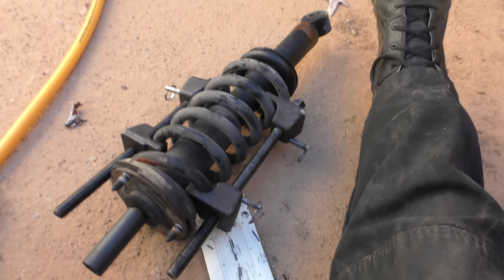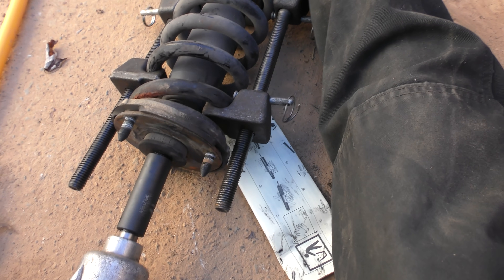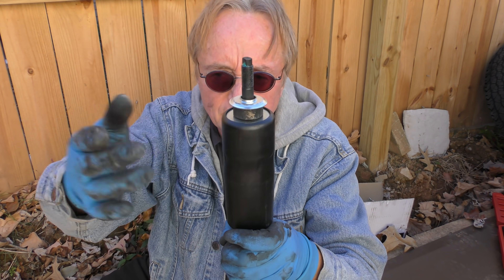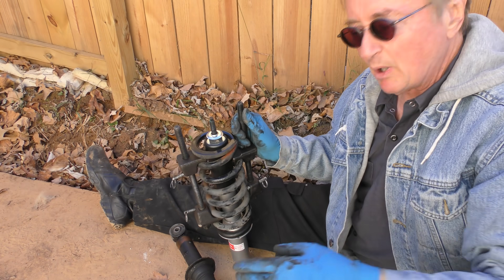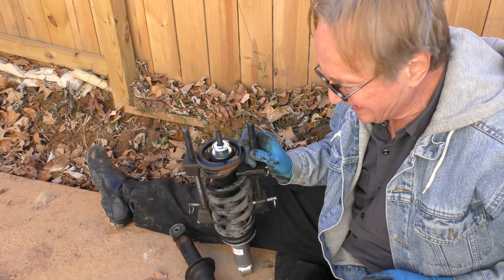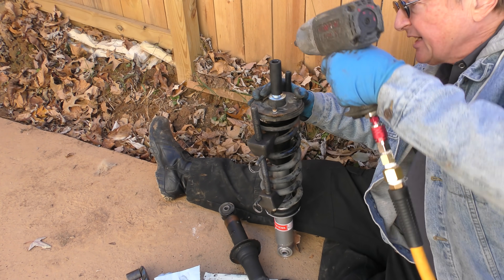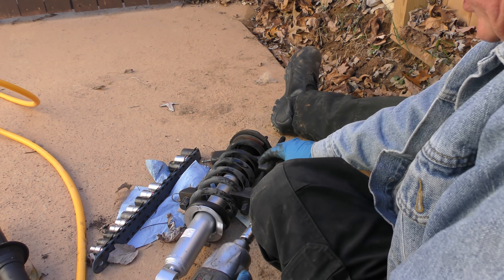It's a lot easier with power tools — you can use hand tools but it's a lot more work, that's why I have power tools. Off it comes. Notice it didn't fly off and hit me — if I hadn't put the spring compressors on, it would have flown off. Out comes the old worn-out shock. The kit comes with all the new plastic parts and bushings, so you put them on, then slide the new shock inside. There are marks on the spring mount showing where the spring fits, so you line that mark up and it fits right on. Then install the rubber, a little metal washer, and the new nut that comes with the kit. Get it nice and tight, then loosen the clamps a little bit at each side until they come off.